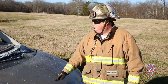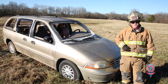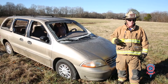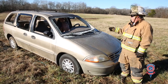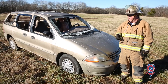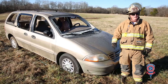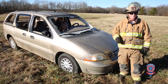On this particular vehicle, we chose a minivan because of the weight of the roof line. If we can do it with a minivan, we can do it with a regular automobile. We went ahead and took some safety precautions so we didn't have to walk you through glass removal. We removed the glass, removed the windshield. The struts on the hatchback on this minivan we disconnected and got them out of the sequence. We checked the plastic around the vehicle for hazards, disconnected the battery, and cut the seat belts.